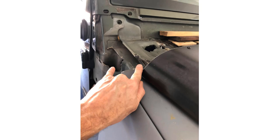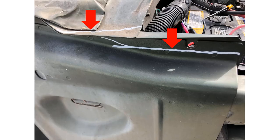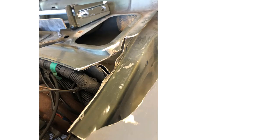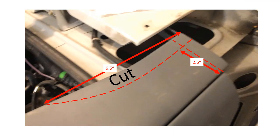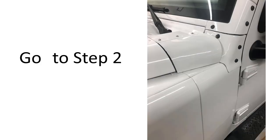In order for the fender parts to fit onto the Wrangler, some parts of the Wrangler must be cut. Notice the white lines showing what I had to cut on each side of the chassis — and here's a close-up view. Here's what it looks like after the cut; that's quite a hole. You can either weld a piece of steel to cover the holes or wrap them in high-density foam insulation, as I'm showing here. You're also going to have to cut the Defender wing — here are the dimensions of what to cut off and a view of the cut from a different angle.